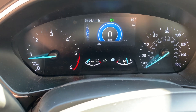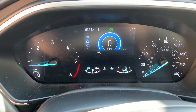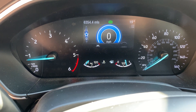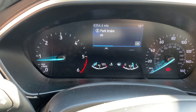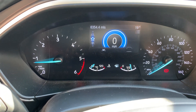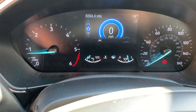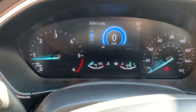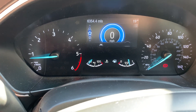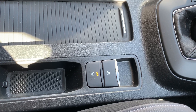It's a good system — it really helps with hill starts, and once you get used to it, it's very nice. This is useful when you're paused for just a very short period of time. A phrase I teach is: when the pause becomes a wait, we put the parking brake on. The parking brake is more secure than auto hold. Another reason to switch to parking brake is that at night time your brake lights could be dazzling the car behind you. On this vehicle, auto hold stays on for approximately three minutes — that could be three minutes of dazzling the driver behind with brake lights lit — whereas once the parking brake's on, your brake lights go out. So that is auto hold and the electronic parking brake explained.